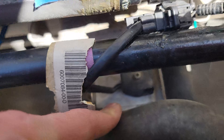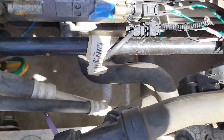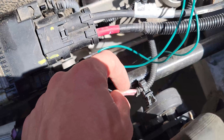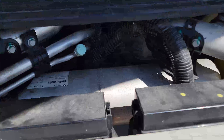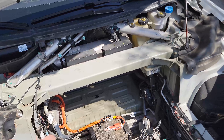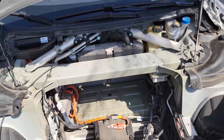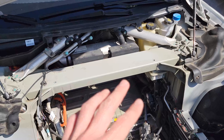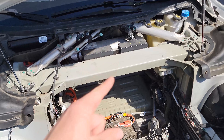These are the AC lines going to some pressure sensor or temperature sensor, and these wires don't go anywhere. There's one down there with one screw on it feeding on the AC lines, and that goes to this plug here, into these lines that are already repaired. The service center said it's pretty common this time of year — it's spring, so if cars were sitting during winter, rodents can come in and chew up wires. Check your wiring if something isn't working or you're getting a lot of error codes.